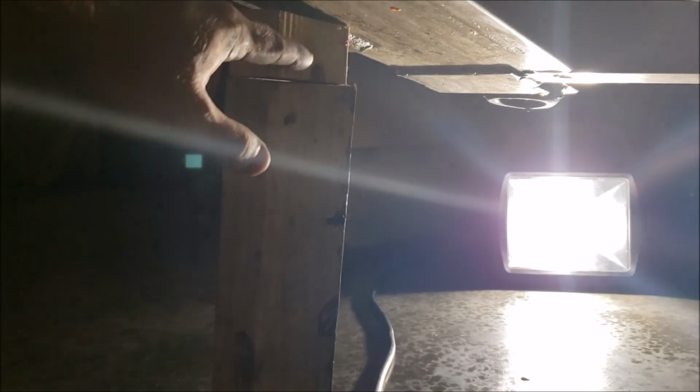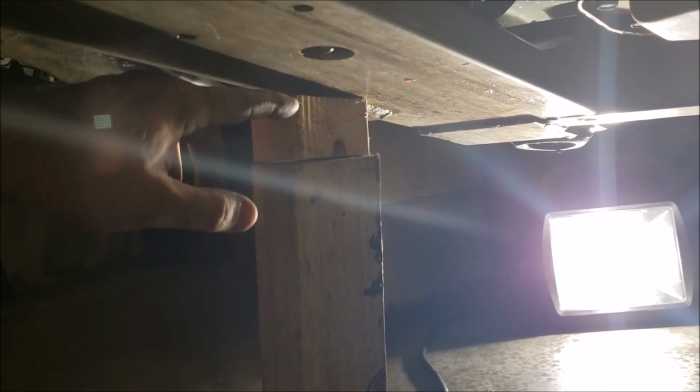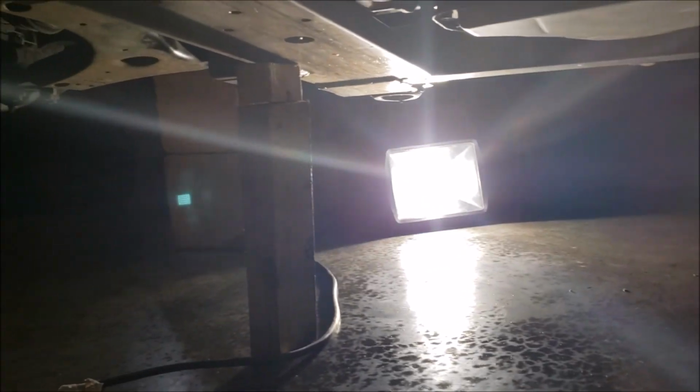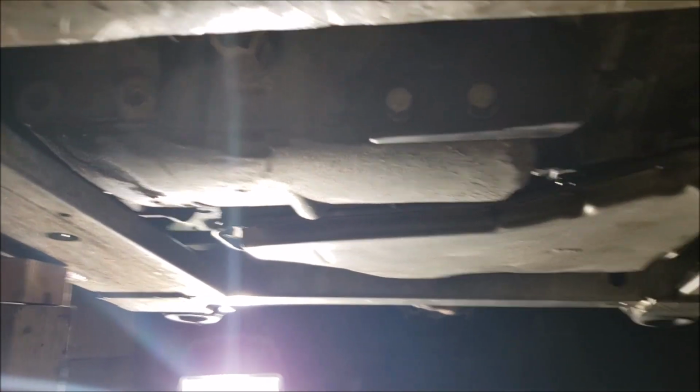was I took a piece of wood, okay? Actually, I used 2 because I was shimming it with different pieces to feel it out. 13 inches. And yes, if you took the top here, my finger can just kind of fit in the edge, so you probably got 1/4 of an inch. So if you wanted to make a line down 1/4 of an inch and then draw it across to the corner and cut that off, it'd probably fit better. But at any rate, by doing that, I'm able to lower the jack onto the piece of wood, and it's slim. So it gives me all the room in the world to work, which you're especially going to need if you do like me and you clean all that.